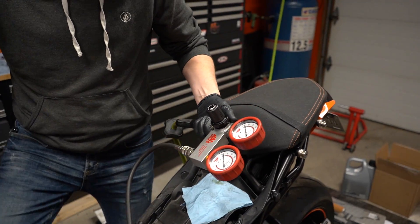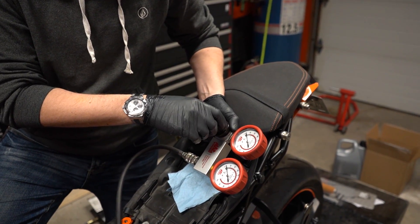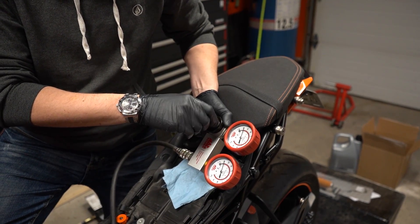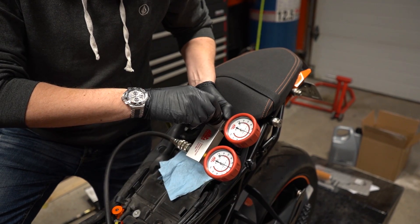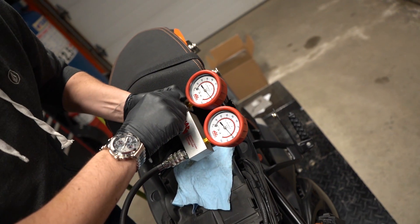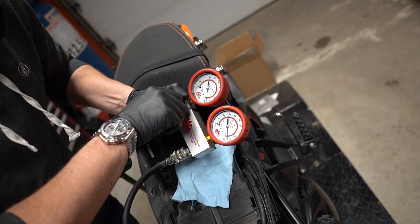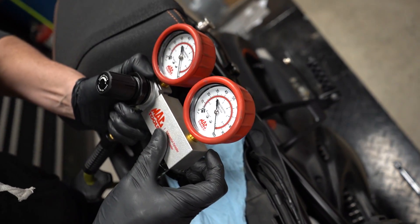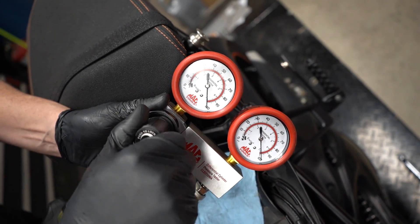The crank's locked, I'm also going to step on the brake, it's in sixth gear right now. And look at that — it's like one and a half to two percent. Tight like she's new!